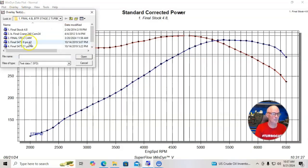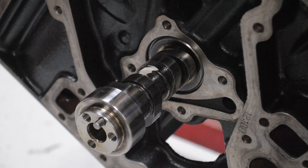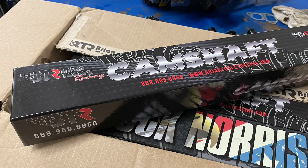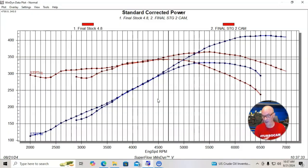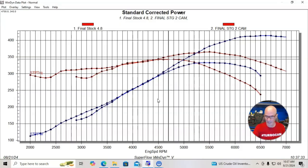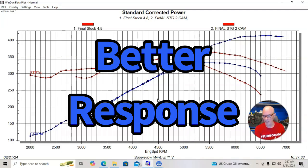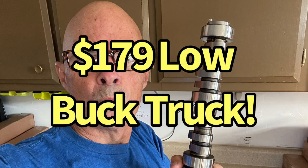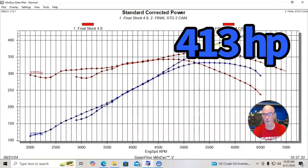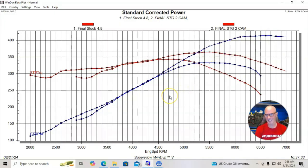Here's what happens when we add a camshaft to it, and this is going to be part of our cost analysis. You can put lots of different camshafts in here. This one is a Brian Tooley Racing Stage 2 turbo cam. I probably would pick the Brian Tooley Racing Truck Norris cam for this 4.8 liter because you can easily make 600 horsepower with a cam, it would have better low speed response. You could also use my $179 low buck truck cam, the Chupacabra. Cam and springs on a 4.8 gets us a little over 400 horsepower — 413 or 414 and 365 foot-pounds of torque.